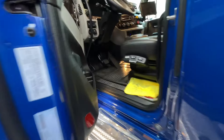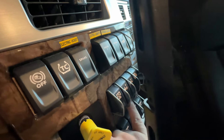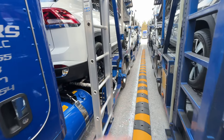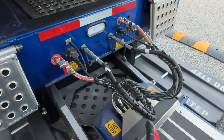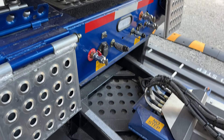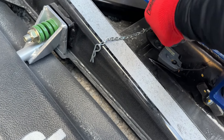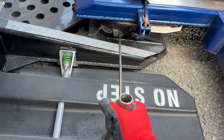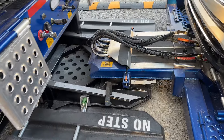In the truck we have a little button here. It shows fifth wheel down and you just pick it up — it starts deflating the airbags on the drives. And here we have this special tool that unhooks our trailer. Next, we're going to disconnect all these lines that go from the trailer to the truck. Now that all the lines are disconnected, we're going to pull out this little pin right here, just like this. And this is our little locking pin. We're going to grab this stick, place it in here, and we need to pull hard — I'm going to use both hands. And there we have it. Once this is all the way out like this, you're good to pull forward and we will be disconnected.